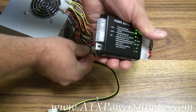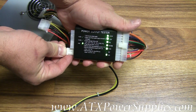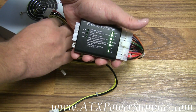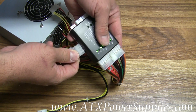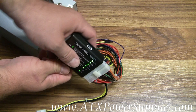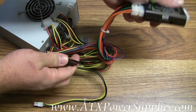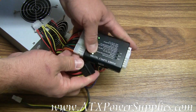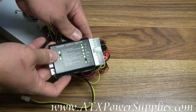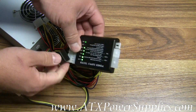Is my floppy drive performing correctly? Plug the floppy drive in and you see I've got the plus 5 volt lighting up for the floppy drive. Check out the Molex connector — got the plus 5 and the plus 12 volt lit up, looking good. Got some SATA connectors over here, so let's flip the power supply around and check out the SATA connector. Plug in the SATA connector and the 12 volt and the plus 5 volt light up like they normally should.